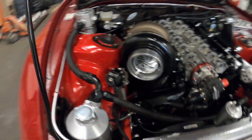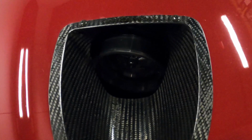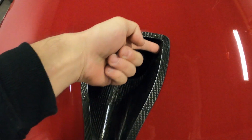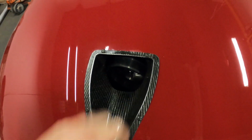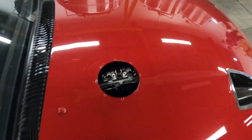So all these pie cuts are gonna have to go pretty close. I mean, considering that it was on the old turbo, but we're gonna have to cut it a little wider here like this because of a 6-inch hole, make it a little bigger. And then the turbo's kind of right, I don't know if you see it, but it's right there. So we're gonna have to enlarge this hole and make the exhaust out of pie cuts, and then fit this one in there.